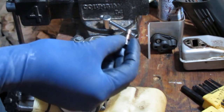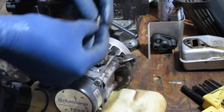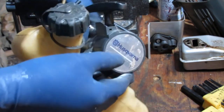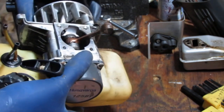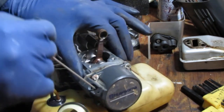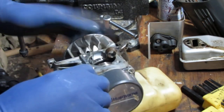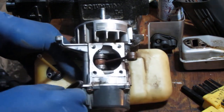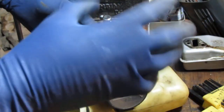So this sat inside of that, like this, which then sat inside of that. Okay. I should have forecasted that. How could you have metal on metal without something to ease the friction, you know? Okay. I see. That's the way it fights. The engine turns clockwise. See? Oops, sorry. And I'm trying to turn it backwards. And the recoil spring is getting bent up onto itself.